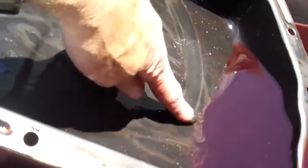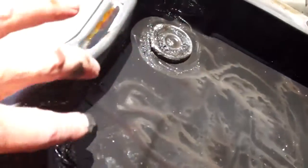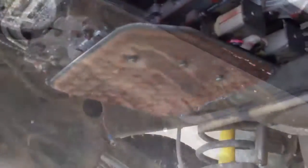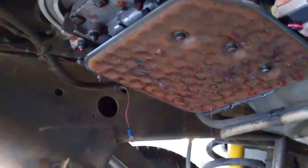You don't expect it to be clean, but I just want him to see that so he knows what it is. I'm not sending you off if something's about to blow up. I wanted to get a shot of that to show how restricted the filter is — you can see the perforated metal imprint into that filter. This is the hydraulic governor. This doesn't have the governor pressure solenoid and transducer that ought to be right there. Look at that filter, it's definitely plugged up. Something's making metal, but I think he'll be okay to make it back home. We're just going to service it out, call it good to go, and send him down the road.